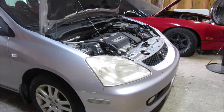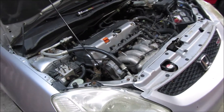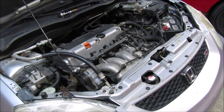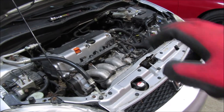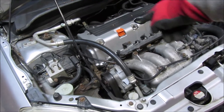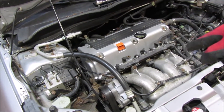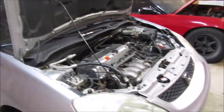What I'm going to do now is take the valve cover off and line it up to top dead center to see how far off we are. I've got a new timing chain and tensioner to put in anyway, but I just want to verify what I already know. I'm not really going to show how to change the valve cover — it's self-explanatory. If you can't change the valve cover, I wouldn't recommend attempting the timing chain. It's just a couple of 10mm bolts for the coil pack covers, a bunch of 10mm for the valve cover, and a couple of hoses and connectors.